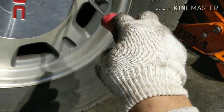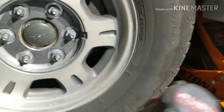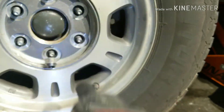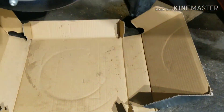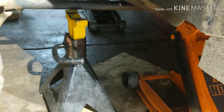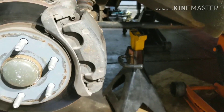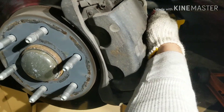Alright, so I get my 22, drop it on the drill. You can use a flathead here too — go behind there, pop this out, put it on the side. Get the wheel off. Get a box or cardboard under it because there's gonna be a lot of metal rust and trash falling down. Now, get a safety jack stand for backup. I'm gonna turn the wheel all the way to the passenger side — see if we can pull it here.